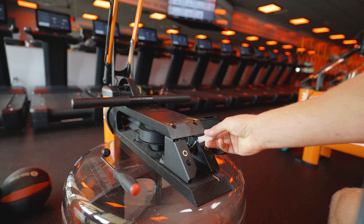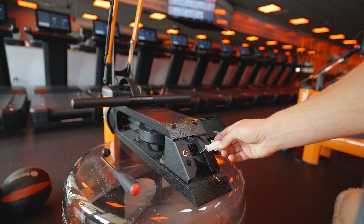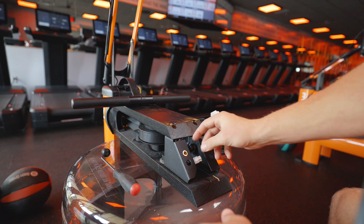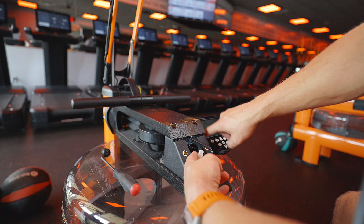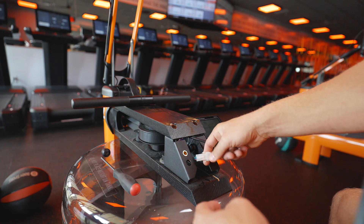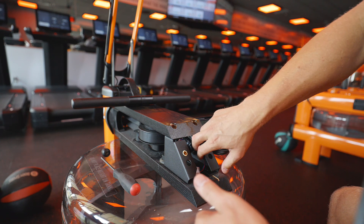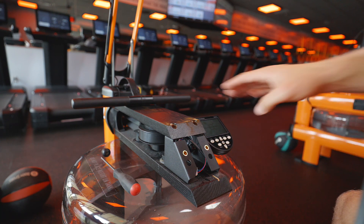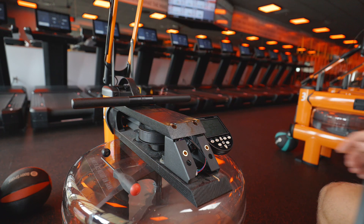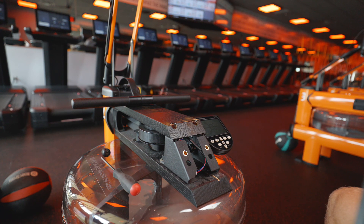This wire right here — very rare, but it's a possibility. This wire leads to the actual sensor disc, and the one with the actual clip leads into the back of the rower monitor. Double check that — if you're not reading any watts at all, this could come disconnected, or a maintenance person might have accidentally forgotten to reconnect it. So always double check that. Now this will give you a lot more access to actually adjust that sensor disc from both sides.